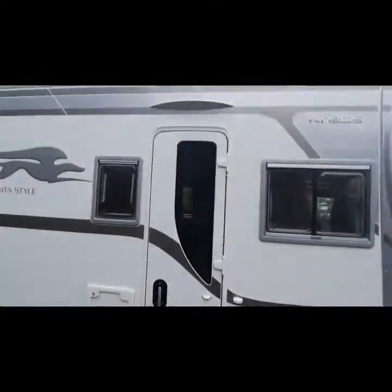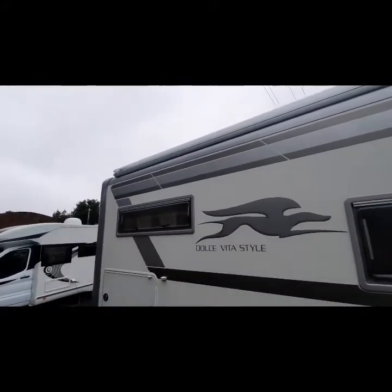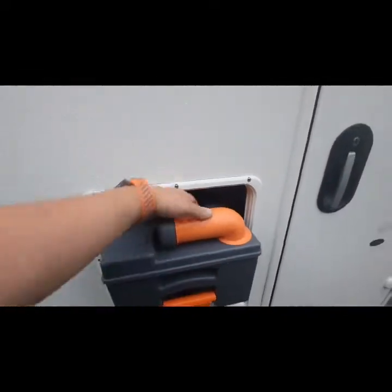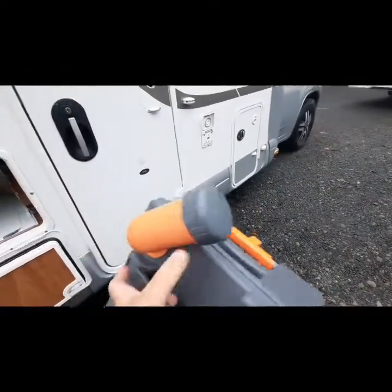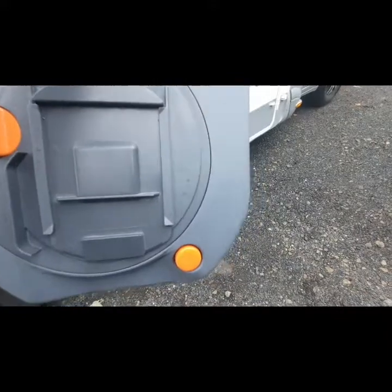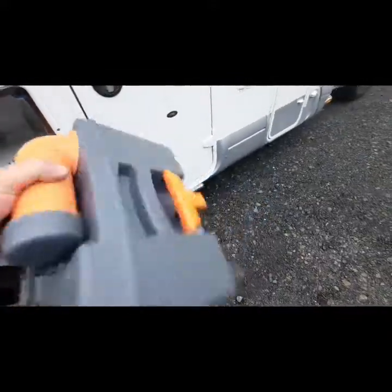Your habitation door has your awning light and awning; the awning opens at the end on that side with the hook supplied with the vehicle. Toilet cassette: press the two buttons, let the drawer come down, lift up the handle, slide it out, remove the grey cap, turn it upside down to empty it using the vacuum button at the bottom. Press that in to stop any splashback and let the air flow out of the unit, clean it out, put the cap back on, and slide the toilet cassette back in.